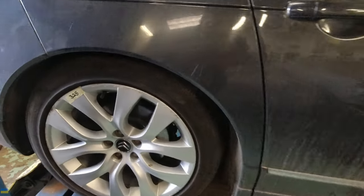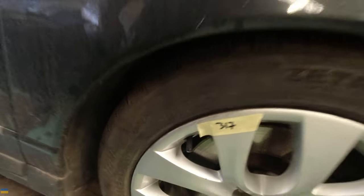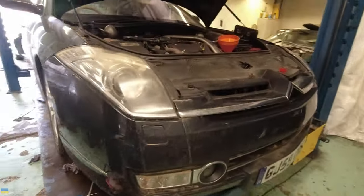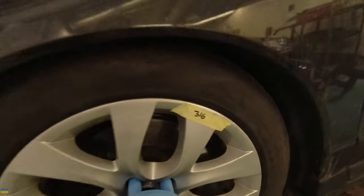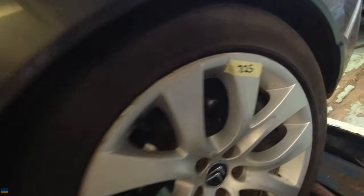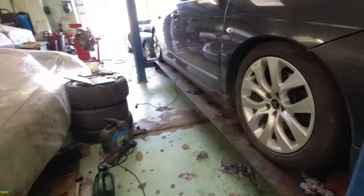I've done the tyre pressures. I'm going to go around and measure all four corners, writing the measurements on the wheel. I pushed a button on the laptop and now the suspension has sunk — but I think that's normal. I've measured all the radiuses: 325 there but only 317 there, 316 there and 325 on the near-side rear. Unlike the last set of wheels it's actually pretty even, and tyre tread depth is the thing that makes the biggest difference.